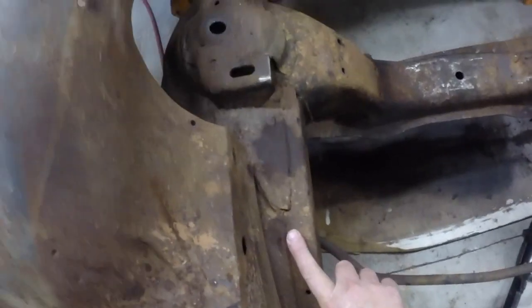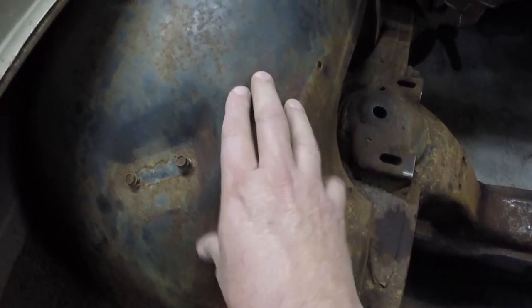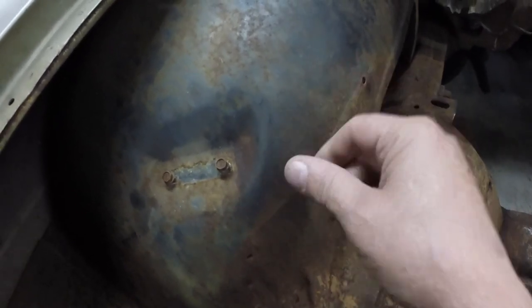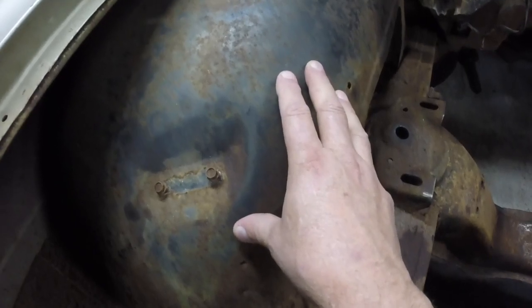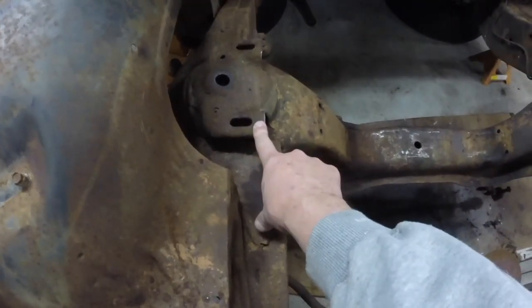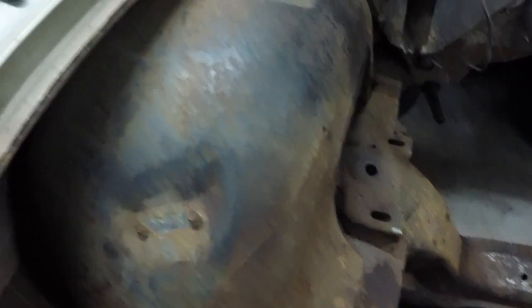I think I'm going to paint the chassis first, then paint this area using a different paint — a really good fuel-resistant, chemical-resistant paint like an acrylic enamel. The only thing I can get in a low-gloss black single-stage paint is urethane, and it's $200 for a quart with hardener and reducer to do the inner fenders. I don't know if I'm going to use that or not. I've got a couple gallons of acrylic lacquer I could use — I just don't want it super shiny, but it's got to have a bit of shine. The chassis and underneath the car are all going to be Rust-Oleum, but I want the inner fenders in a good fuel-resistant paint.